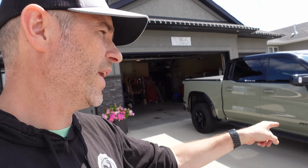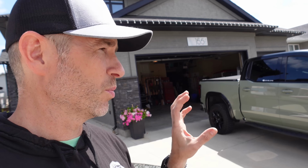So there's two reasons for you. Number three is these wheels do not have a cutout in the back. Now, some of you might wonder, why didn't I use the 1.5-inch spacers that I had that we put on the Escalade? Well, I needed to go with the 2-inch because they had to clear the stock lugs. These rims do not have a recess like the factory ones do to allow for, say, a 1.5-inch spacer with the ability to still put the factory rim on because it has those cutouts for where the new lug position is. So those are the three reasons.